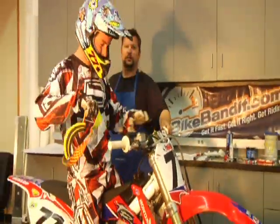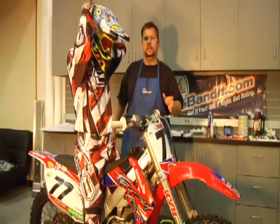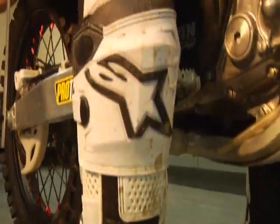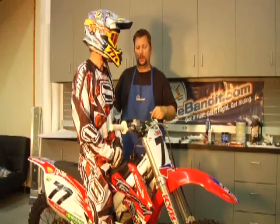Okay, so what we've got is we already know we're at 0. I highly suggest that you and your buddy get together to do your sag. Dress up in your gear, because your gear adds 10 to 15 pounds to your weight with boots and a helmet and everything. So to get precisely accurate, dress up in your gear, get your buddy to help you.